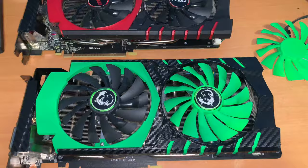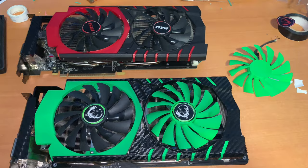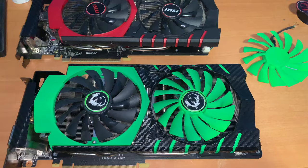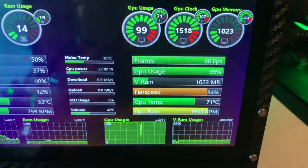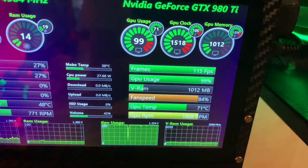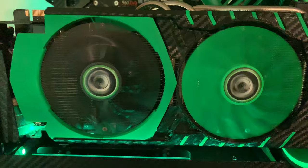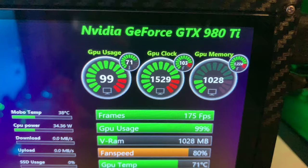This was a smarter way — I just used a soldering iron and it was much quicker. It doesn't make any performance difference because the 980 and 970 use the same fans. If you want to see how I painted them, you can refer to my previous video from about six months ago called 'How to Paint Your GPU', and another video where I carbon wrap it. Looking at the specs, you can see the fan speed is much higher because the temperature is over 70 degrees. I'm running my own custom fan profile that I'll probably adapt — 70 degrees is where I'd like to keep it, maybe up to 75.